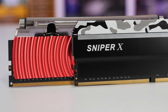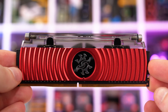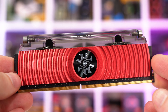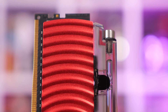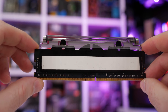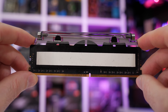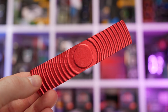When it comes to the more technical stuff, ADATA doesn't really give away too much on their website. You'll read that they are indeed liquid-cooled using non-conductive fluid with a low boiling point to dissipate heat effectively. No technical information on the liquid is given, and I have asked ADATA but they haven't got back to me yet. The liquid is hermetically sealed, meaning it shouldn't leak. The phase change process absorbs a lot of thermal energy, intended to take heat away from the PCB and memory chips. Connected to a clear tube on top of the modules is a thin aluminium heat spreader, connected to the memory chips via a thin adhesive thermal pad, transferring heat to the liquid via two small tabs at either end. Since this is single-sided memory, there is just one black heat spreader that connects to the liquid tube. The opposite side features a decorative red piece of aluminium, also found on the front side, covering the black heat spreader and locked into position using double-sided adhesive.